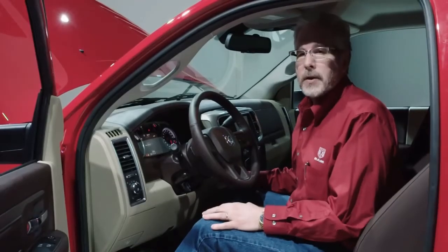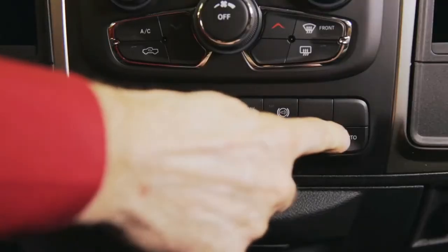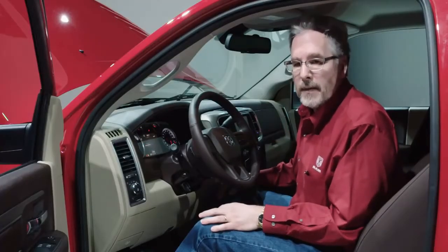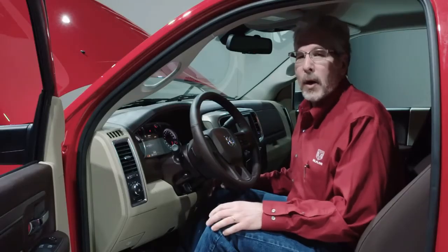The first thing I usually do is a quick vehicle self-test. I start the engine, come over, and press the PTO button. The RPM should ramp up to 900. The PTO light will flash — eight seconds on the gas and 30 seconds on the diesel — at which point PTO will drop out and the vehicle will return to idle.